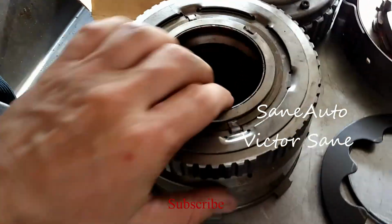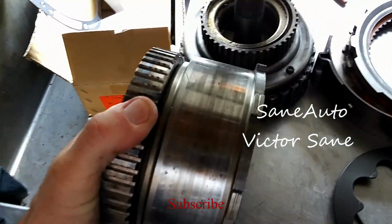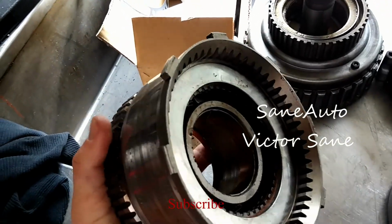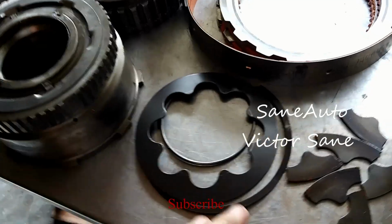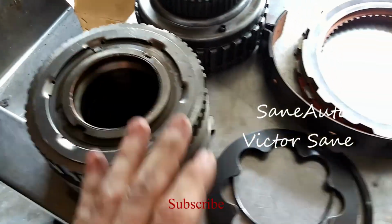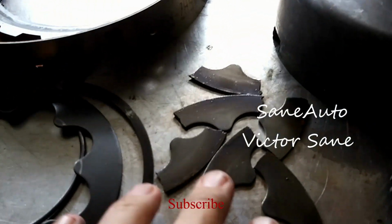Next is the reverse input drum. Like I said, there's going to be a whole other video about this alone because there's a lot of things you need to know. When you take the clutches and stuff out, I'll go ahead and give you one of the secrets for this. You're going to find a Belleville spring, and it usually looks like this.